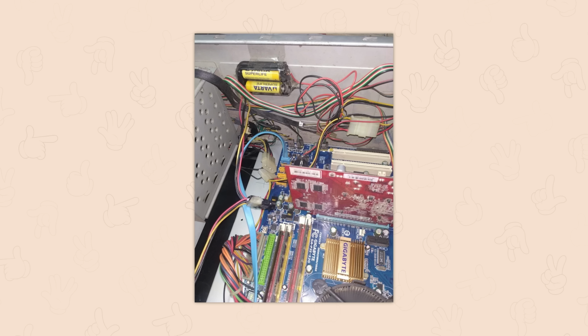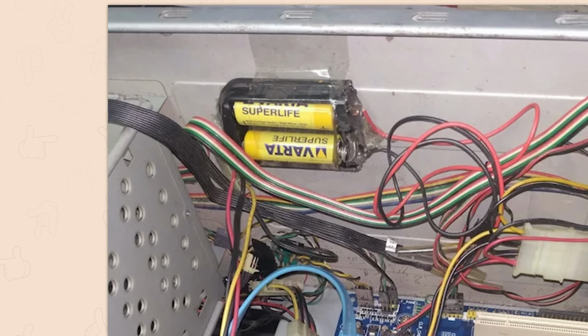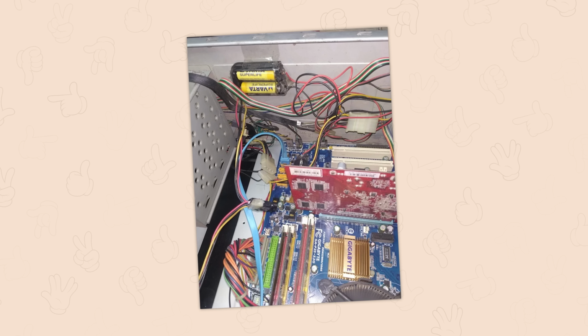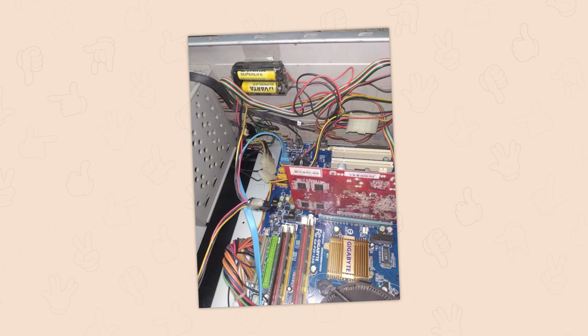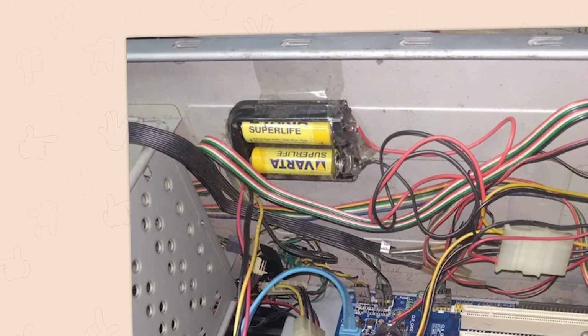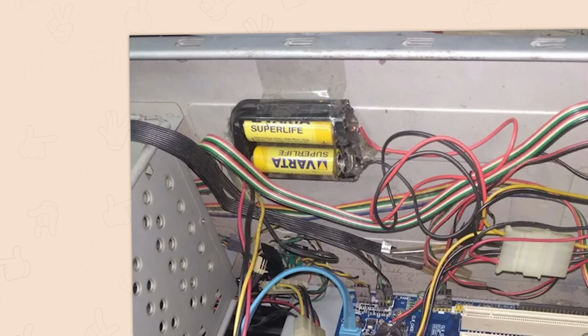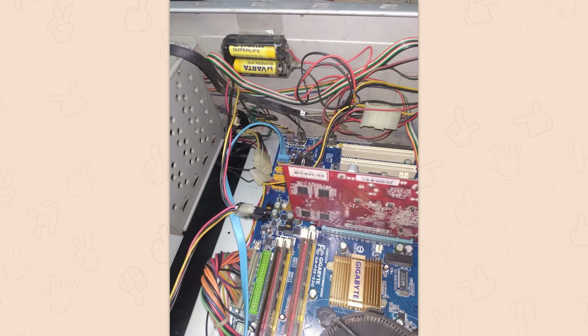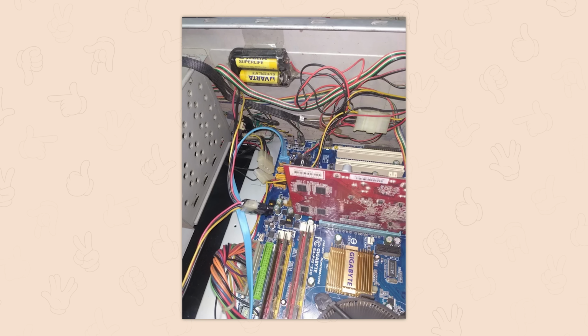All right, so there's a tiny battery on the motherboard called a CMOS battery, and it's a little coin cell, and it goes bad after, I don't know, 5-10 years. I heard something once that there were rechargeables of them at some point, but I don't remember. But yeah, what they've done is just took two giant batteries. I'm guessing they're 3.7 volt something or others because they look weird. And hooked that up to the CMOS, which should last you years, like literal decades.